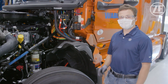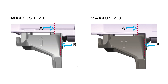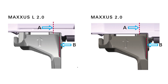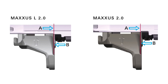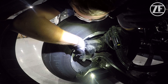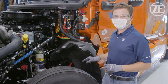For our wheels on inspection we have two measurement methods. We have a caliper casting notch — there's a notch in the caliper piece and you can clearly see where the material changes. The furthest outboard point on that notch will move inboard as your pads wear, until it meets up with the face of the caliper pad carrier. That is when your pads are worn to a point where a wheels off inspection should be done. We'll check that notch right now, and that notch hasn't reached that point yet.